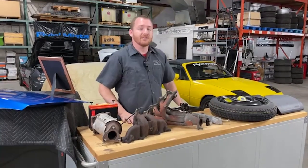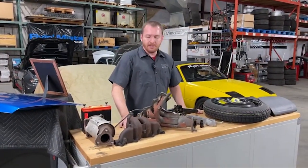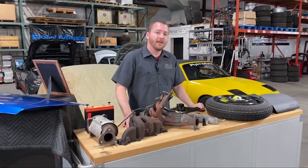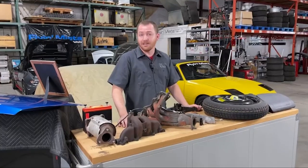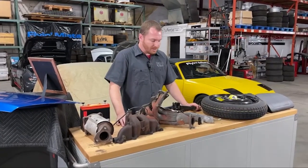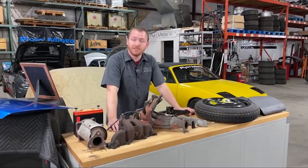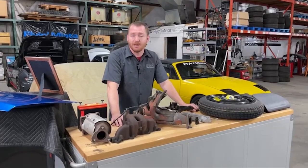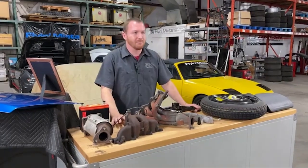Another common one for stock parts swapping, especially for NAs and also NDs if you're tricky: the stock wheels on NA and NB Miatas. Some of the early cars had 14-inch wheels with very light wheel options — some were as light as about 10 pounds, and there are reports of some of the BBS model wheels weighing slightly less than 10 pounds. They're very hard to find, but there are also 7-spoke 14-inch stock wheels that are about 10.5 to 11 pounds. If you're looking to reduce unsprung weight, we need to stop and talk about unsprung weight.